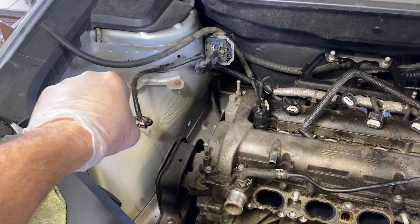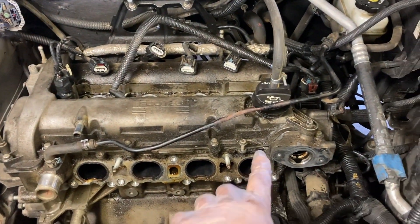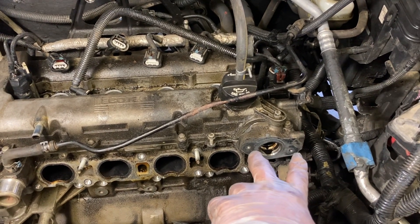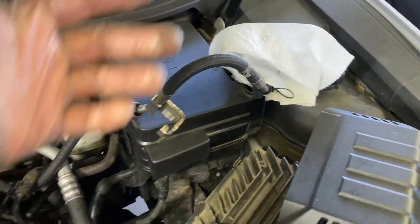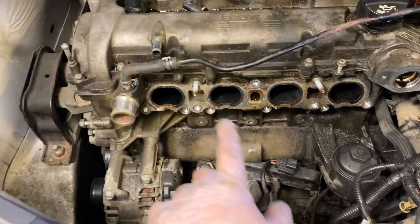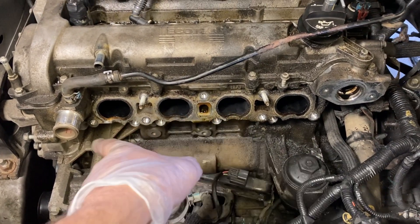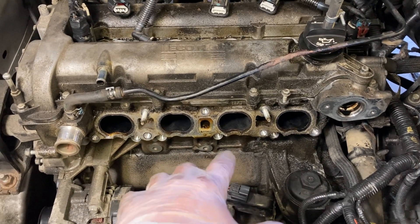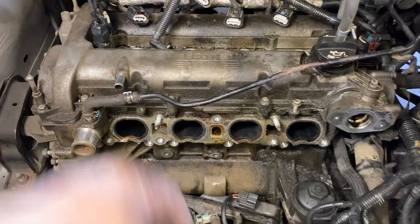At this point I've got the air box out, the shield off, and you've got to take this high pressure fuel pump out — that's quite simple to get to, nothing crazy about that. The intake manifold you've got to unbolt and pull back a little, then take the four bolts out that hold the fuel rail in, wiggle the fuel rail out, and then the intake manifold will come right out.